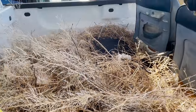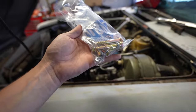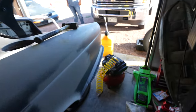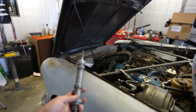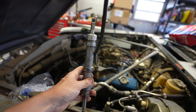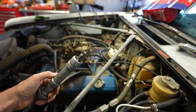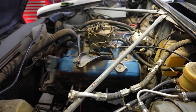I made it back - got some bolts for the manifold so we'll get those slapped on. I also went ahead and got some fuel - five gallons of pump gas to throw in the fuel cell. I went ahead and picked up this handy tool from my dad - this actually goes into the distributor and turns over the oil pump so we can prime the engine and don't dry-fire it. We can get some oil up into the top side since this thing has been sitting so long. It's probably a good idea to get some oil into this engine before we crank it over dry.